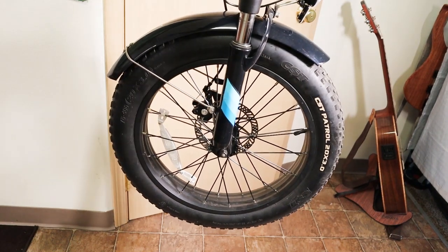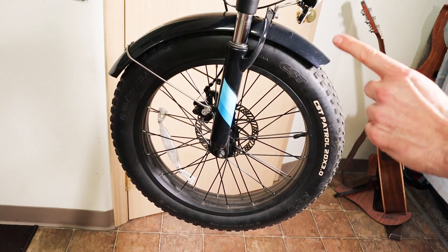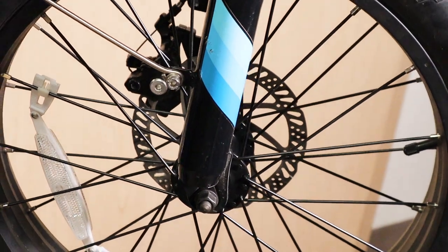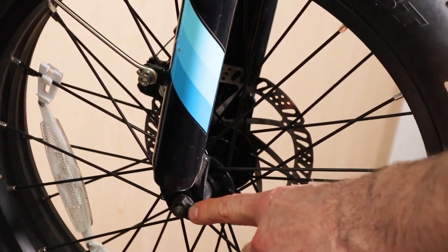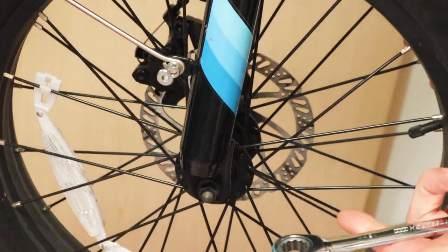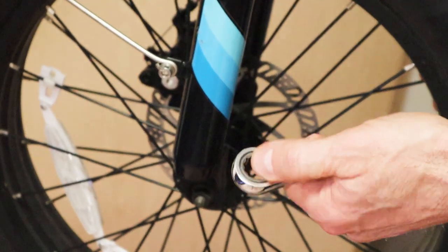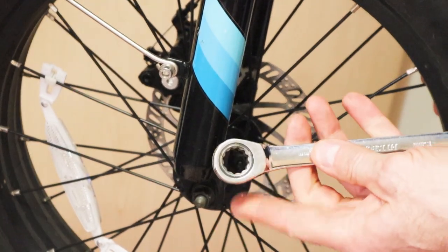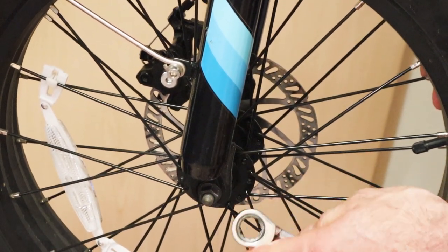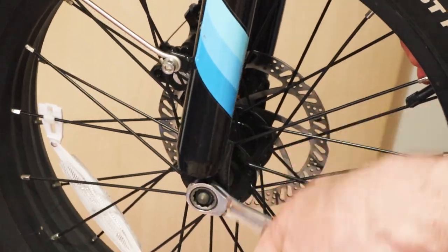The first thing you're going to need to do when you want to work on the front wheel is take off the front wheel. So if you look real closely, way down in here, you need to get these little 15 millimeter bolts off. The best tool to get those off is a 15 millimeter wrench. I like to use these ratcheting ones, and I'll leave a link in the description below to a 15 millimeter ratcheting one. You can also use a crescent wrench or something like that. But as you can see, this is just a whole lot easier.